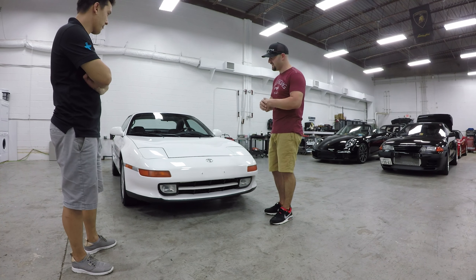We did a light machine polish — we're not achieving perfection out of this, there are still defects within the paint. The goal behind today was to restore depth and clarity loss to the paint. There are still deeper scratches that are going to be an issue, but the goal was to remove the oxidation and put a shine to it — give it a little more character and make it look clean. The end result makes it a more acceptable car. John, I seriously can't thank you enough. Hours are Monday through Friday 8 a.m. to 5 p.m. and Saturday by appointment only, located in Dulles, Virginia, right next to Dulles Airport.